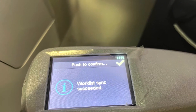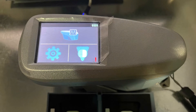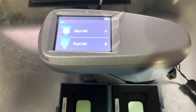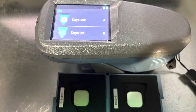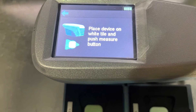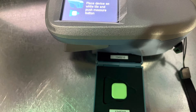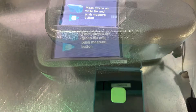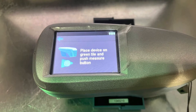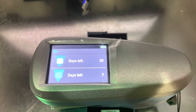Now that the synchronization is complete, we need to make sure that the color camera or spectrophotometer is properly calibrated before we take our reading. By clicking on the bottom corner which shows the two colors, we can check — and here it shows us that it does need to be recalibrated. Follow the directions on your camera to complete the calibration correctly. This one requires a reading of a white sample and then a light green sample. If you do not calibrate your camera, either it will not work or you could get very poor readings, which will create a poor color match.